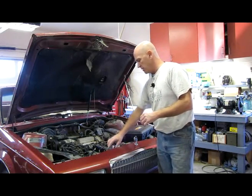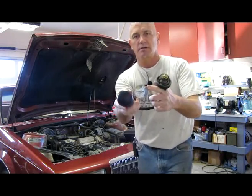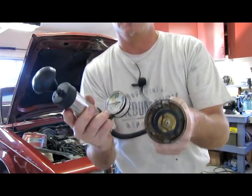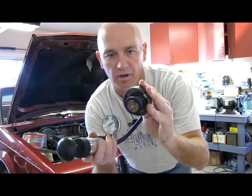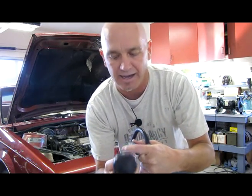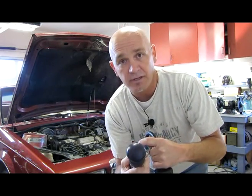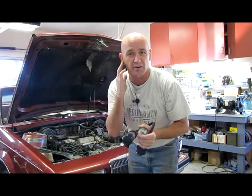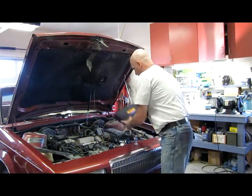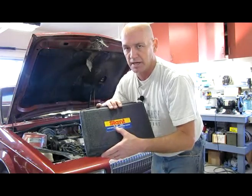The way this thing works is pretty cool — it's just like a tire pump. It's got a gauge here. You hook this end up to the radiator neck, then you pump it up to however high your cap says. Ideally it's going to hold pressure; if not, the needle will slowly go down and you'll either see where it's leaking or hear a hiss. This one happens to be made by Stant, which is a pretty common manufacturer of radiator caps and that kind of stuff.